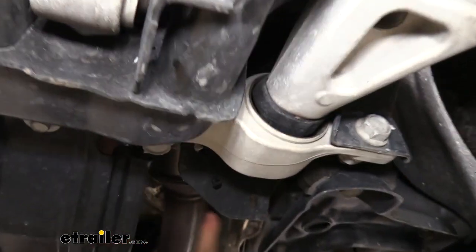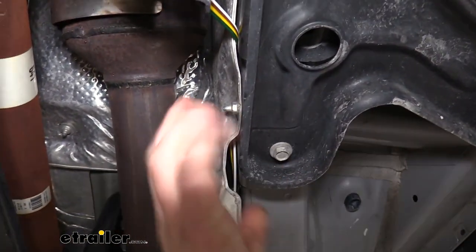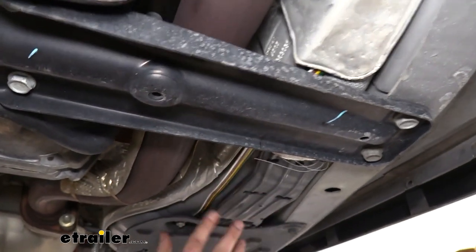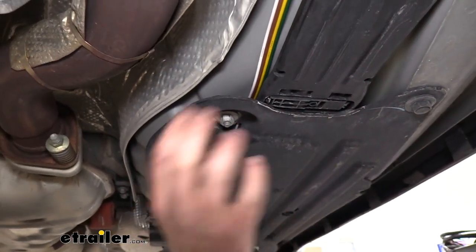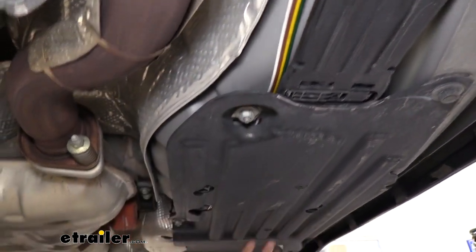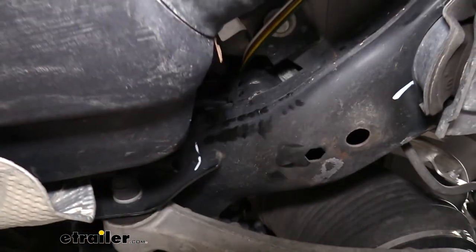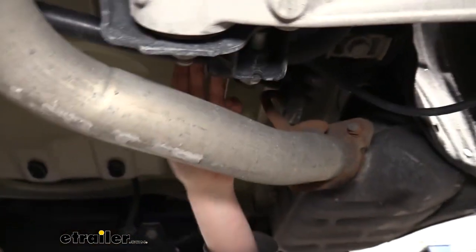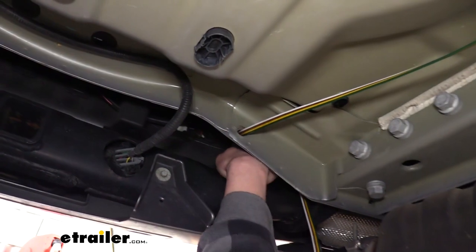From there we come out the back of our subframe and tuck it behind the heat shield located here because we want to protect from the heat from our exhaust. I did remove the small nut right there with a 10 millimeter socket to poke the wire up and then I just put that nut right back on. We then continued going rearward staying behind the heat shield until we come out where our plastic paneling is. From there we stay above the plastic paneling all the way to the end of the panel — there are two nuts that I took off to get the wiring in there, just use a 13 millimeter socket, remove them, push the wiring in, put them back, and it comes out at the back of the plastic panel. We go alongside our fuel tank staying above our subframe. At the back there's factory wiring that we can zip tie to and follow towards the rear, then we went through the small hole at the back and zip tied to the factory harness there.